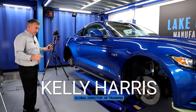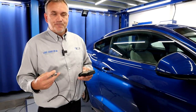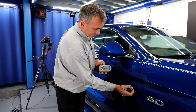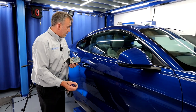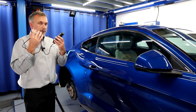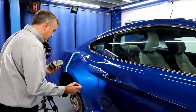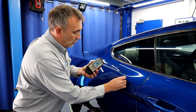Before I start talking about this phenomenon, this unusual issue, I'm going to do the paint — this is total thickness, so this is your primer, colour, clear coat. 124, it's in microns. 120. For reference, a piece of A4 paper of really good quality is about 80 microns. Human hair does vary a lot, but it can be around 100 microns. So paint is thin. We've had a range of about 108 to 120 — 118 — so you get an idea of thickness.